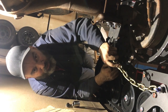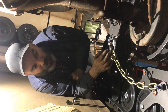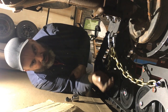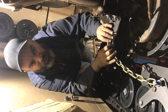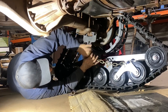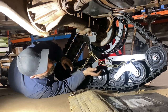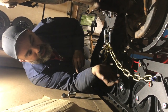At the end of the day this is your responsibility — so if your tracks hit the body because the chains were set too long, that's unfortunate. Also, these chains are not indestructible. If you're flying along and there's a hole — like a creek running under the snow — and the track dives into it and you're going so fast that the chain can't hold and the truck weighs four thousand pounds, things are going to break. This is meant to keep the tracks out of the body under normal operating conditions. If you're going to give it full send, that's your risk. Whatever you do on one side, you can mirror to the other side — if you're three links in on one chain, be three links in on the other.